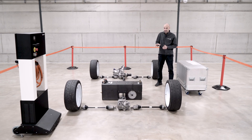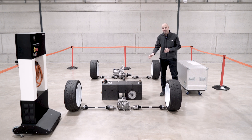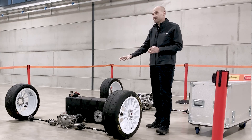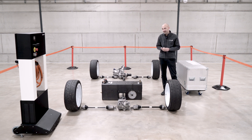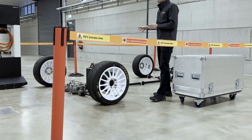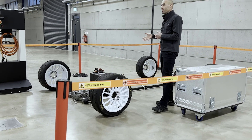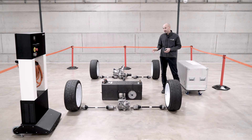The hybrid unit itself is driven through a separate driveshaft into the rear differential — this is a Rally 2 differential that we're showing just for today; the Rally 1 differentials will look quite different to what you've typically seen on a previous World Rally car. The hybrid unit can give out 130 horsepower, 100 kilowatts at its maximum. The motor and the battery are all combined in one single unit that's supplied to the teams.